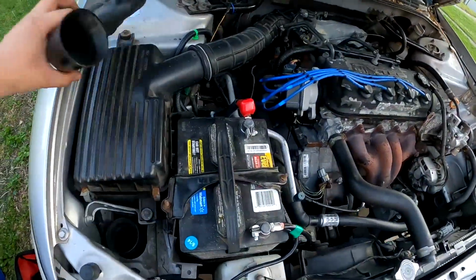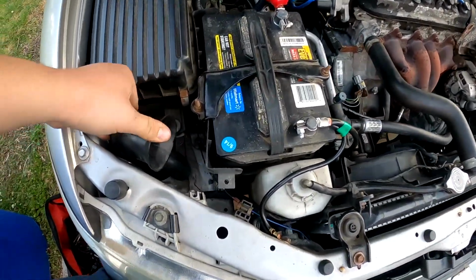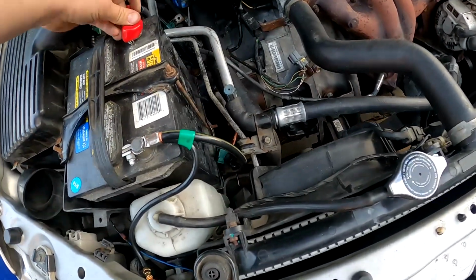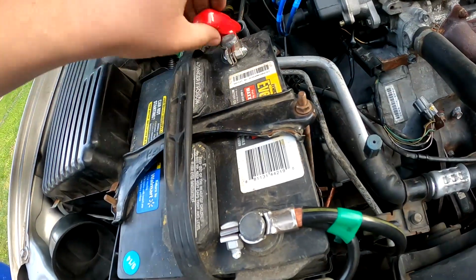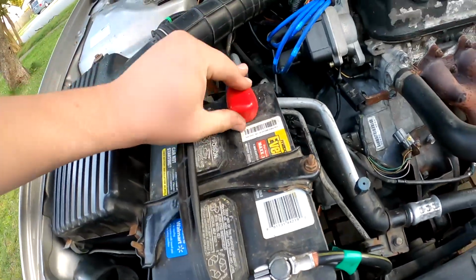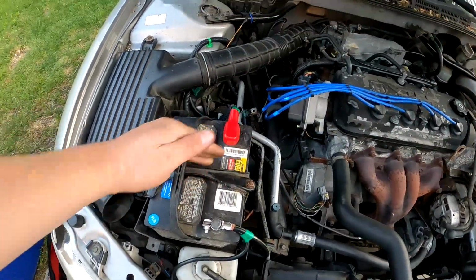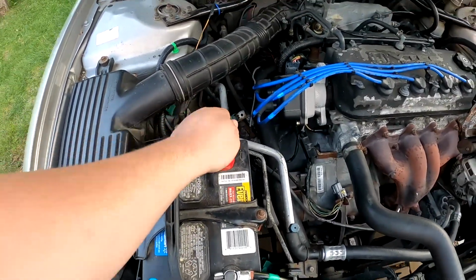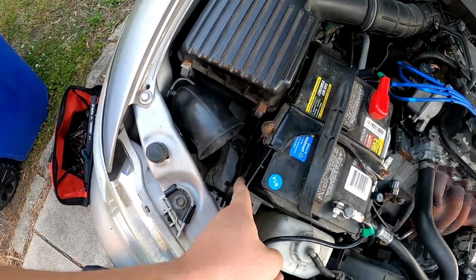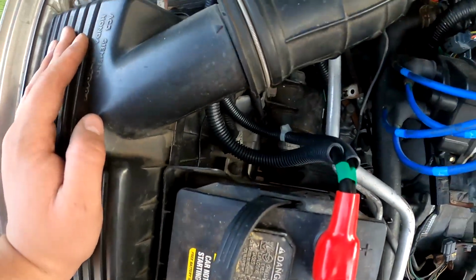The last thing you need to do is put this new intake air duct back in. See, the battery's not going anywhere. And then the last and final piece, it's hard to do with one hand while holding the camera: put your insulator boot on. Keep all those elements away from the positive terminal, so you won't have to use baking soda, Coca-Cola, and a toothbrush on it. But that's pretty much it. And make sure you put your battery tray back in. That's the last thing, which I don't know if I went over, but make sure that's there. But yeah, that is it for the cables.